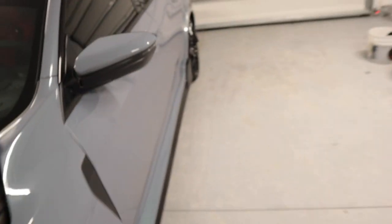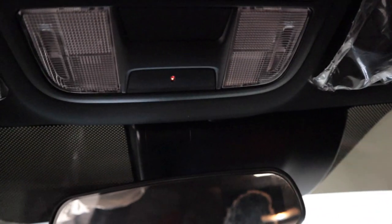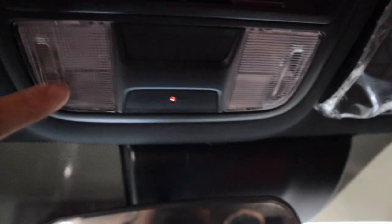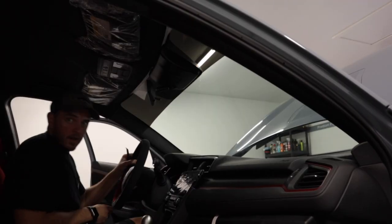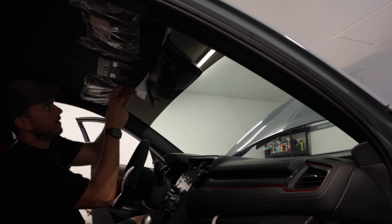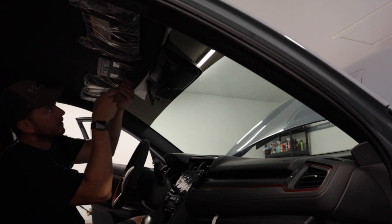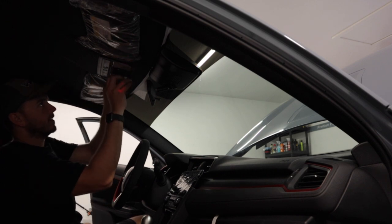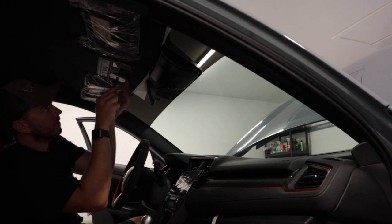Let's go ahead and get to the cab. The first two bulbs we're going to be messing with are these right here — I'm going to cut the power because these do get extremely hot. So let's go ahead and get those covers popped off and put the new LEDs in. This is what it looks like — nasty yellow color, nobody likes that. The first thing we're going to do is take your trim tool piece and gently pry up into the light. This makes it super simple.